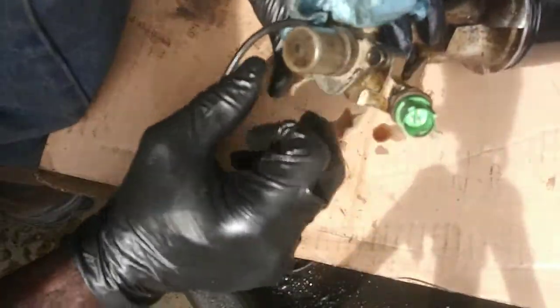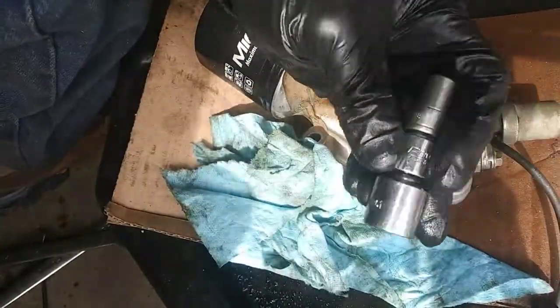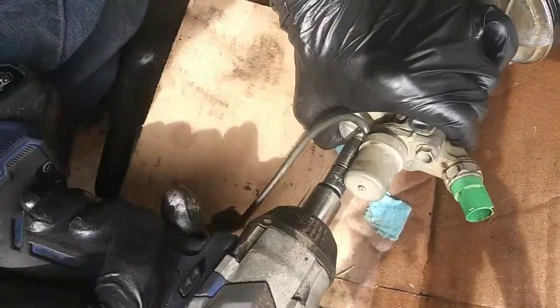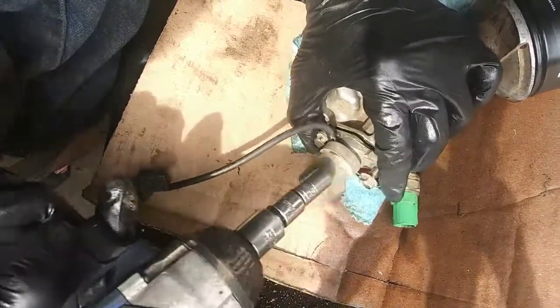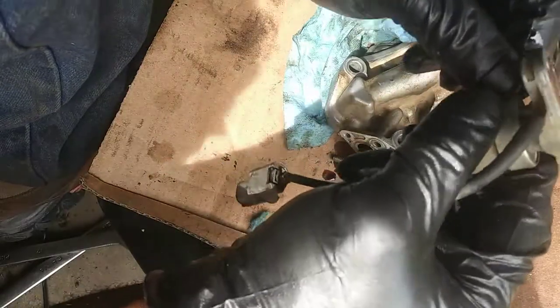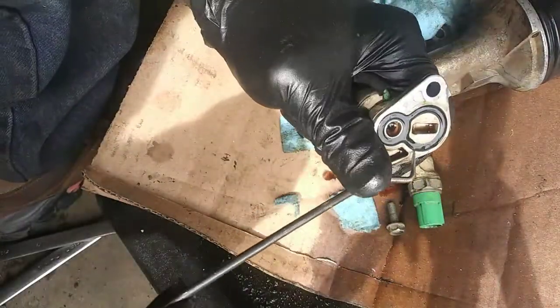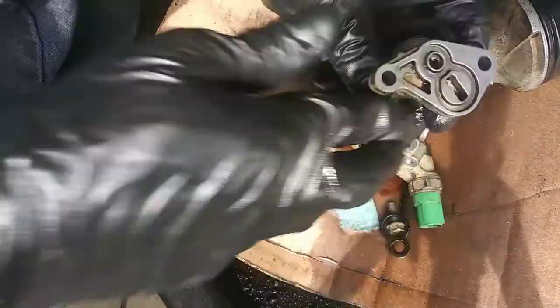Let's take a 10mm, get this off, and we'll take a look at the VTEC gasket. I'm pretty sure that's smashed. Don't laugh at me. I've never done this before, so I never had a reducer from a 3/8 to a 1/4. But it'll work for this purpose. All right, there we go. Yep, the gasket is in fact smashed. It is really flat. Even from that, no big deal, because we get the brand new one. No big deal.